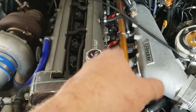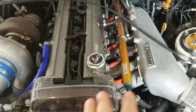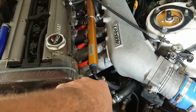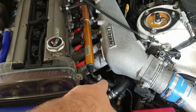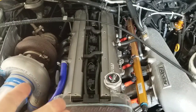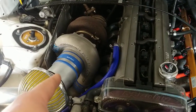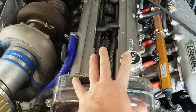You pull these injectors out, replace them with like 1,600 or 1,800 cc's. I would actually personally go 1,600, or 1,200, sorry. But with these, you could probably go like a 2,000 cc injector, ID injector dynamics, change the fuel lines, because those are actually trash. Put the PTFE, which is the AN-8 hoses, run triple Walbro fuel pumps inside the back. Get an AEM just because it's cheap. Obviously, there's much better than AEM, but that's the cheapest option. And a bigger turbo.